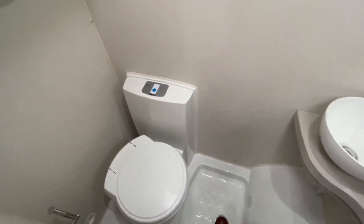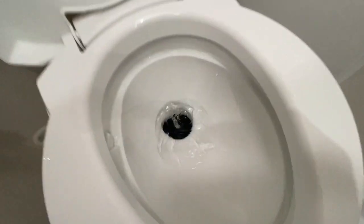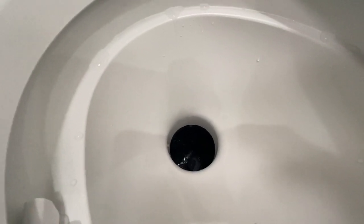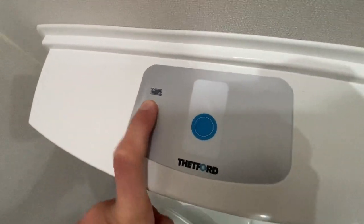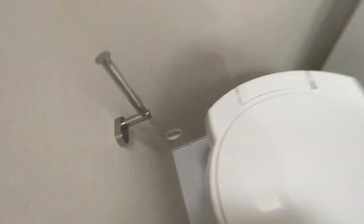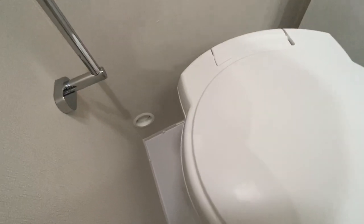To operate your toilet, make sure the pump's on. Press the blue button — it'll then draw water through for the flush. To open the trap door into the cassette, use the grey slide on the side. Open it and that gives access to the cassette. If this is open when trying to pull the cassette out of the side of the vehicle, it won't come out — the trap door must be shut. When the wheel goes red, the cassette is indicating it is full and will require being emptied. You've got your heater duct in there when your heating is on — this is a good place to hang wet coats and put your wet boots in, as it gets really warm.